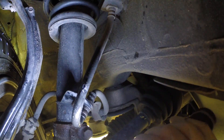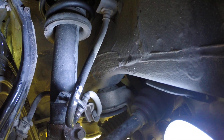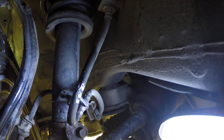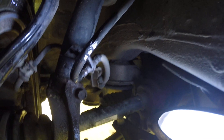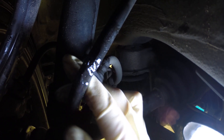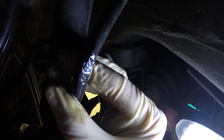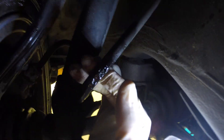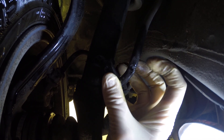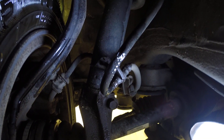It looks very strange to me honestly. Once in a while a brake line might have a situation where it rubs through. It has obviously rubbed on something — it almost looks a little bit like somebody reached up here with wire cutters and tried to cut the line, but I'm not going to get into conspiracy theories. These flat spots give the appearance of having rubbed on something.